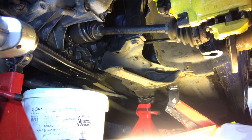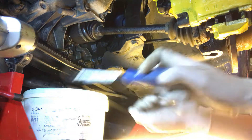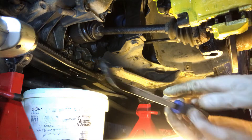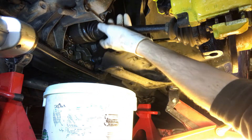I can't actually separate the driveshaft from the hub — it's seized on. I don't want to damage the thread, so I'm going to try to separate the driveshaft from the gearbox side instead and swing the whole thing out, which I probably should have done in the first place. It took about 40 minutes of whacking it, but it's now pulled out a little bit. What I did was use a tool leaned against the housing and hit the handle as hard as I could — it eventually popped out. Now I should be able to pull it out of the gearbox and catch any oil that comes out.